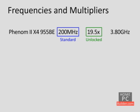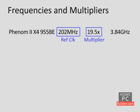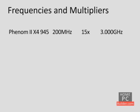This is the easiest way to overclock a CPU, but since the smallest increase of the multiplier is 0.5, the smallest increase is 0.1 GHz, or 100 MHz. To find the absolute highest overclock your CPU is capable of, you can also increase the reference clock one MHz at a time to fine-tune the overclock. In addition to using the combination of reference clock and multiplier increases to overclock the CPU, we will also show how to overclock the CPU using only reference clock increases.